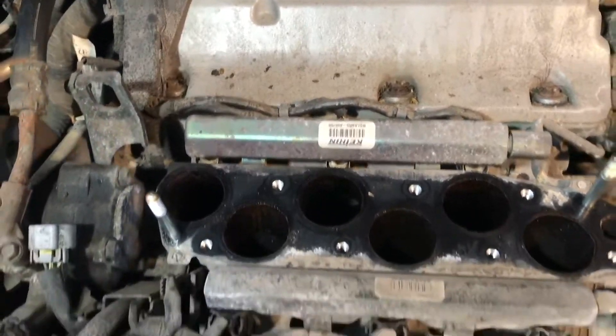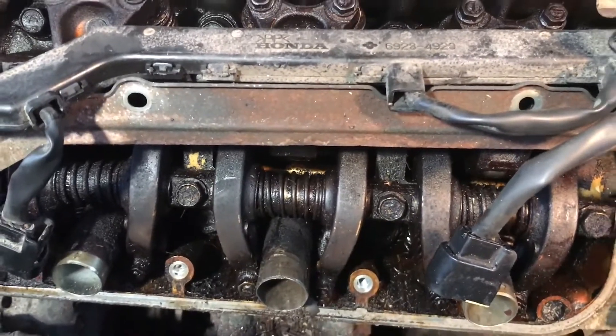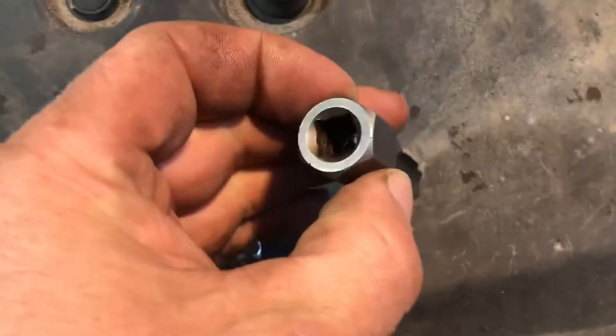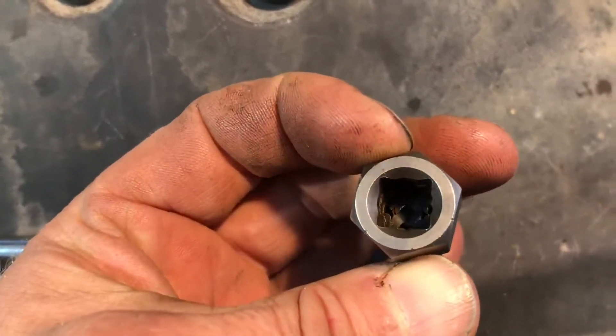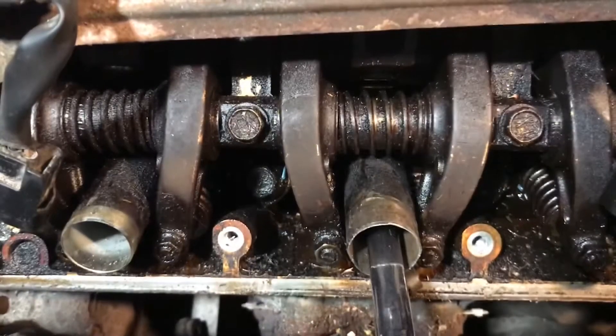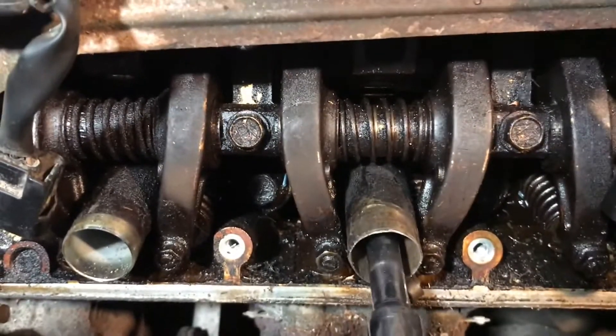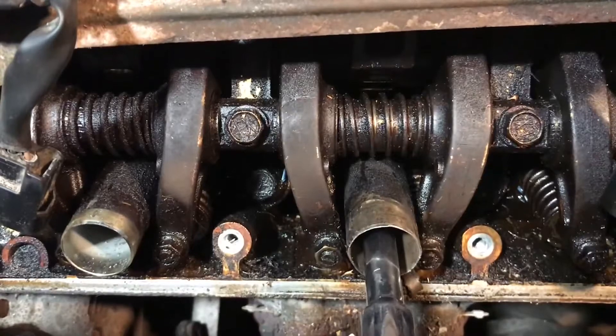I plugged all the other coils and was told to roll the engine over a bit to pop out any debris inside the cylinder. The tap has a socket fitting — it takes a 3/8 drive — so I'm going to put it on an extension. Make sure the piston is not at the very top; roll the engine over enough so the piston is further down so the tap won't hit it when you tap the hole.